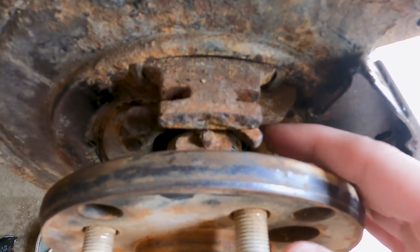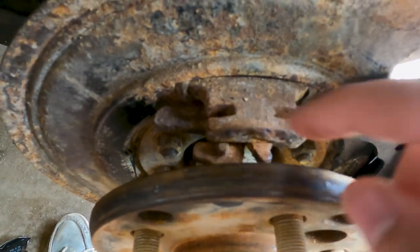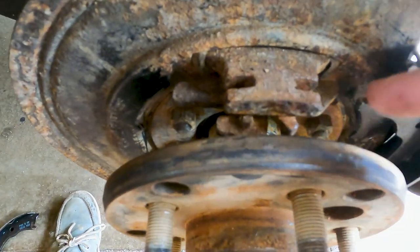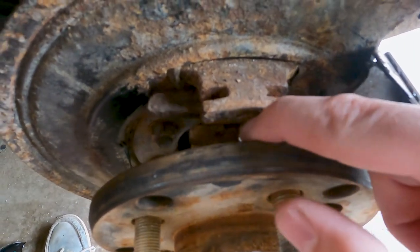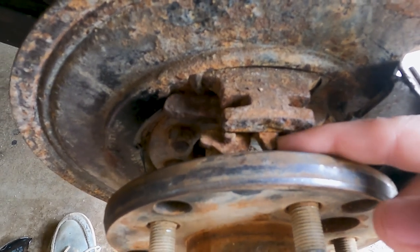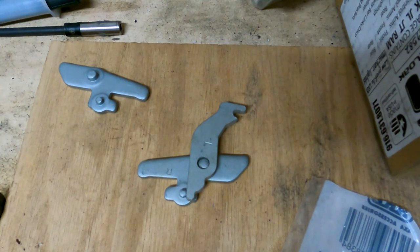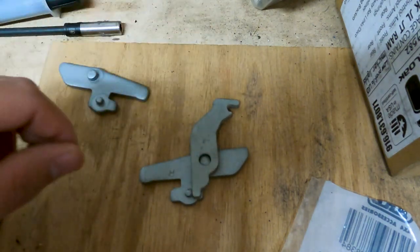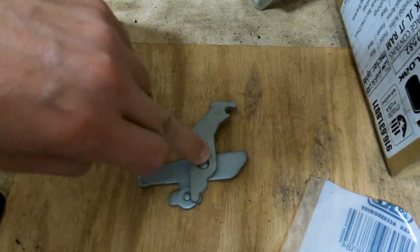This is the other side of that lever. It's a two-piece lever — this is one piece and this is another piece. Essentially this piece and this big bottom piece should move independent of each other, but they are rusted together. So it's not actuating like it should under the spring tension with the brake shoes to move that lever back into place to stay with the cable. These are the replacement pieces I bought — you can see how they are two pieces that move freely. The ones in the Jeep are fused, so it just moves as one piece, and that's not how it's meant to function.